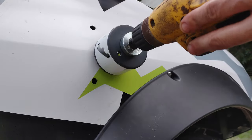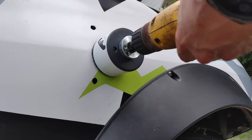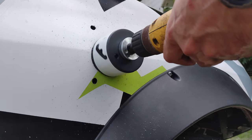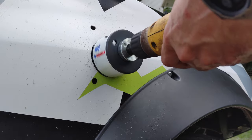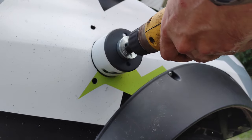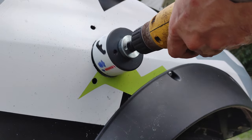Coming in with my three-inch hole saw, drilling out the pilot hole in the middle first, and then we're going to drill out the three-inch hole. This is a little tricky as it is right over a feature line — a bend in the fender — so you kind of have to do it one side at a time. I rock gently back and forth with the hole saw until I carve out a nice clean cut.